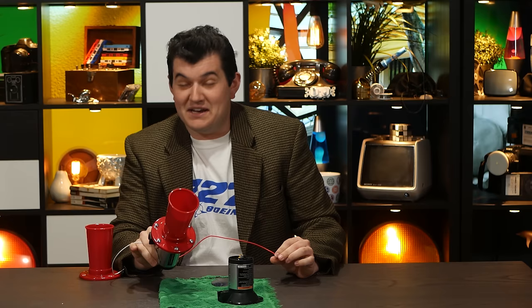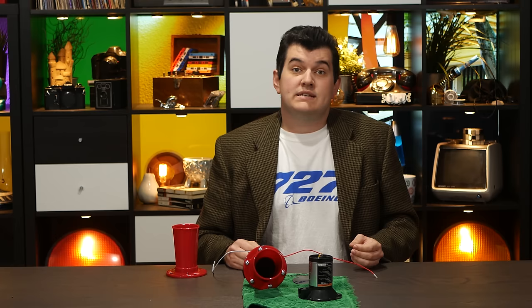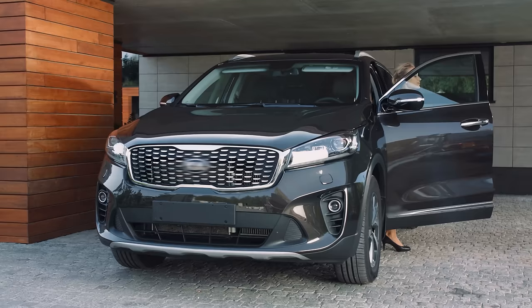This would certainly be an effective horn should you put one on your vehicle. But should you? I'm not gonna say no, but also I am not gonna say yes. It's not quite so easy as just slapping this in where your horn was — you'd probably definitely damage the horn circuit. The best thing to do would be to add another horn button and run a new fused circuit through it to the horn. You don't want this to be your car's primary horn. Not only is it tremendously silly, but if you replace your normal horn with one of these — which you should definitely consider not doing — you're gonna draw some major attention to yourself when you lock your car. And your car alarm will be entirely useless, as in the event of a break-in, any would-be do-gooders will simply think your car is diving below the surface.